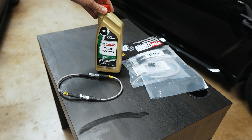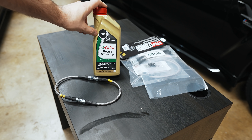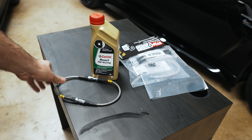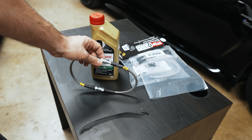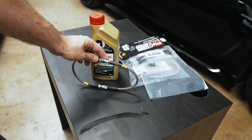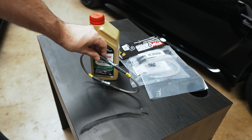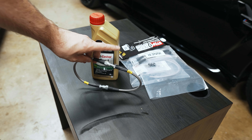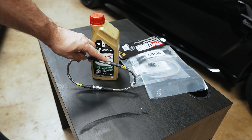So what I'm going to do today is upgrade to racing fluid — it's better than the factory fluid you normally put in your car. One liter will flush the entire system and I'll show you how to do that on an E90 or E92. We're also going to upgrade to steel braided brake lines, though I'm doing this more for maintenance because they have 200,000 miles on them. When you upgrade to steel braided brake lines you may notice a little better pedal feel, but probably not under normal use — only when you have so much heat in the fluid that it would cause the rubber to expand, basically in extreme situations. The combination of these two working together should help make a spongy pedal basically impossible when you have a lot of heat in the rotor.